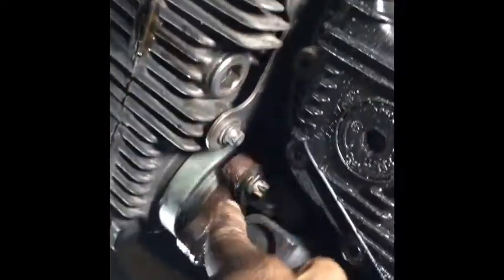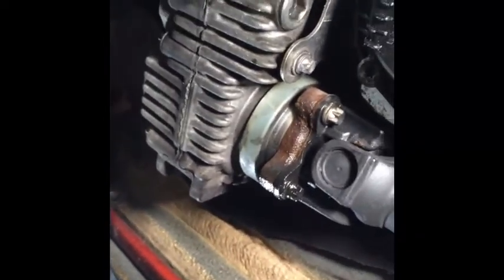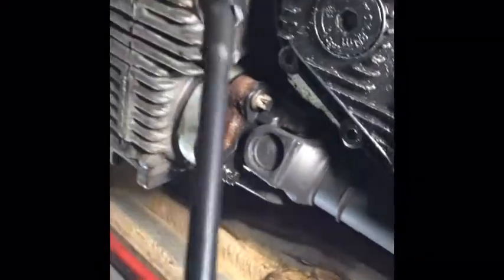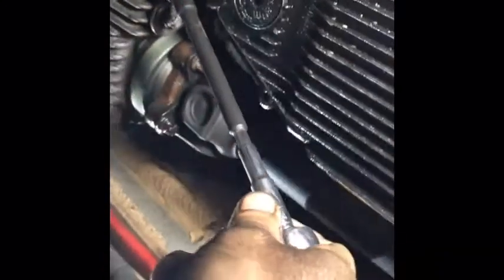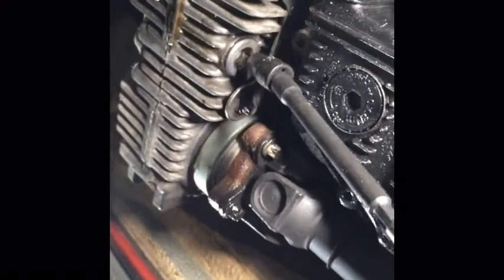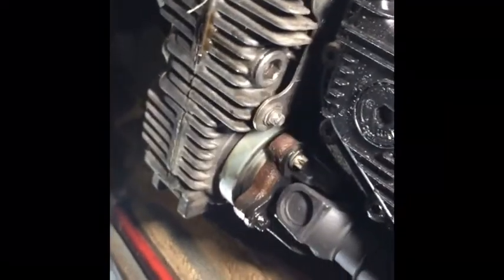The problem is the drain hole here. This drain hole is so close to the plastic transmission oil pan that when you put the socket or driver in, it jams against it and you can't really use the wrench. I use a breaker bar with the hex socket to break it loose, then remove it using a wobble extension. That wobble extension allowed me to tilt it slightly and remove the drain plug without jamming against the plastic transmission oil pan — this really saved the day.